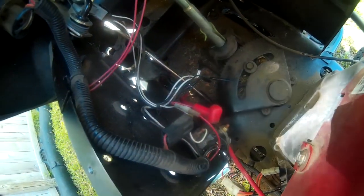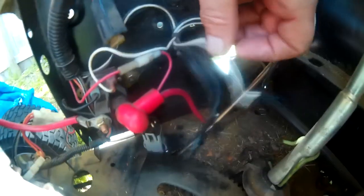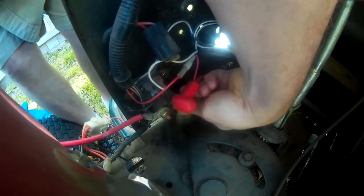This is a quick video on how to bypass the brake switch. It got to be a total pain in the butt with this switch, so I clipped all the wires and bypassed it. Now it works great. After I bypassed it, it also bypassed the seat switch on here too — that little switch where you can get up off the seat and the motor won't die on you. This little switch is what the brake rides on.